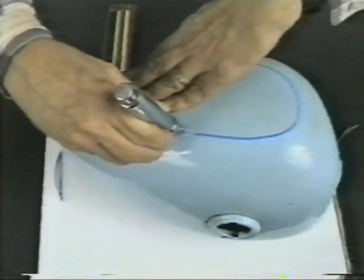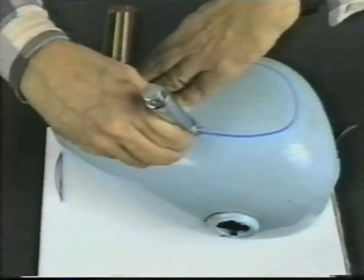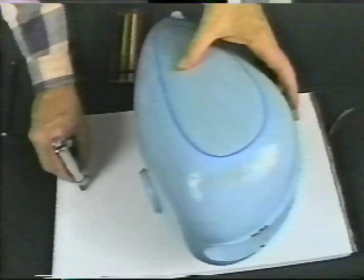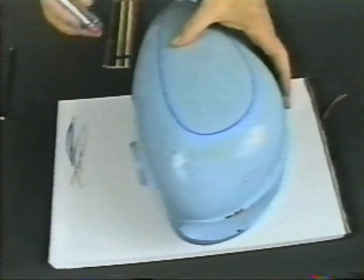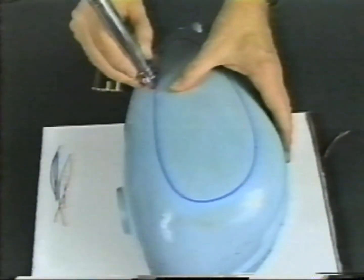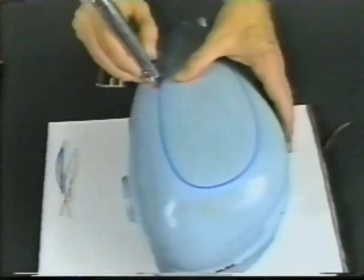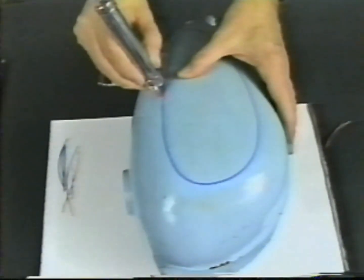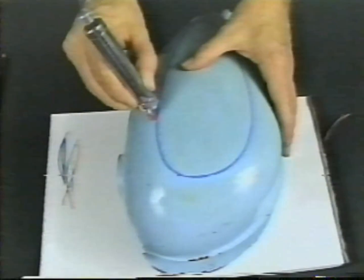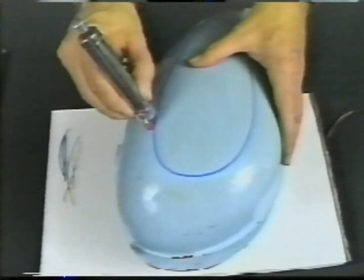For the second line, the painter will use the shoulder located next to the wheel as a sight to maintain an even space between the two lines. Push the tool forward with a steady motion, keeping the shoulder of the wheel head alongside the edge of the first stripe.